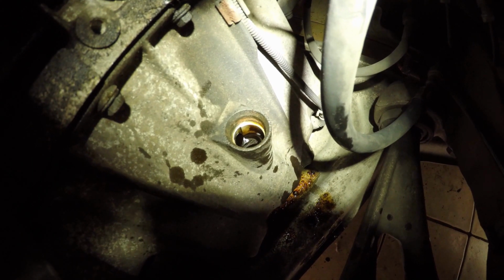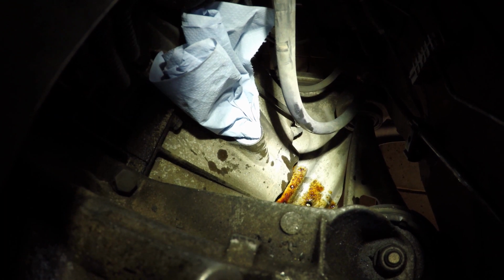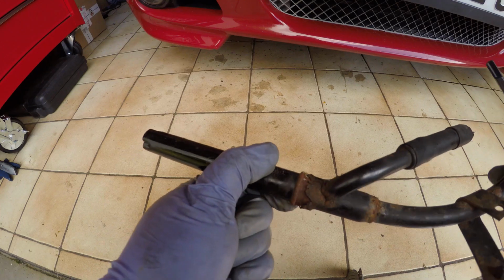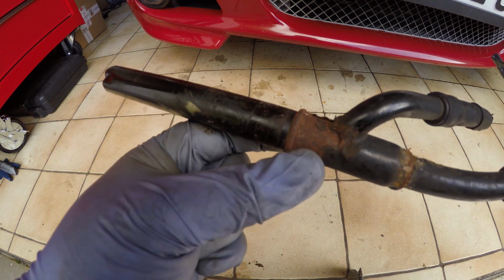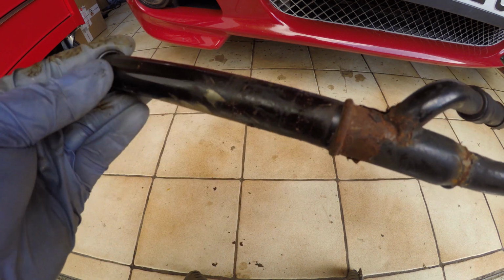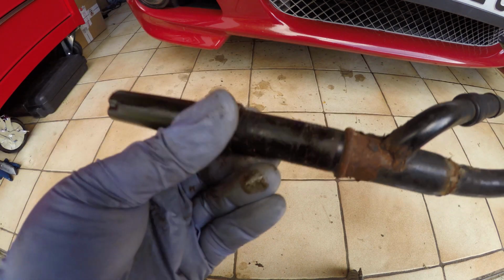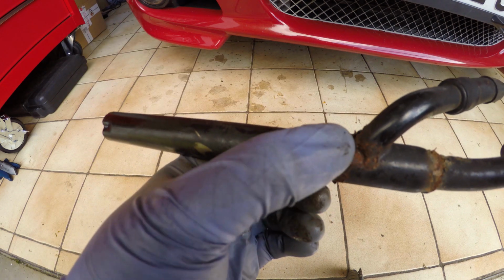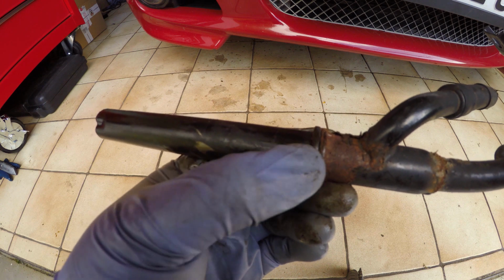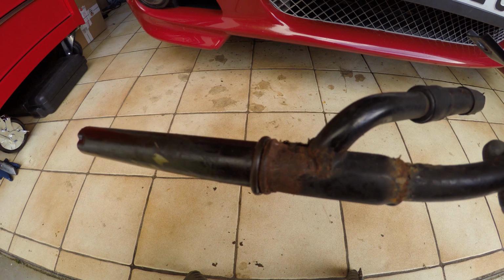Clean a little bit of that machine surface where the O-ring sits, and then I'm just going to stuff some blue roll in there to prevent any further contamination. There is a fair bit of peeling paint you can see here, and rust, and that's one of the reasons why so much dirt had got into the area where the O-ring was. The O-ring would be sitting there, that's the old one, and all this flaking paint, some of it had dropped into the hole for the sump, and that's what I picked out.